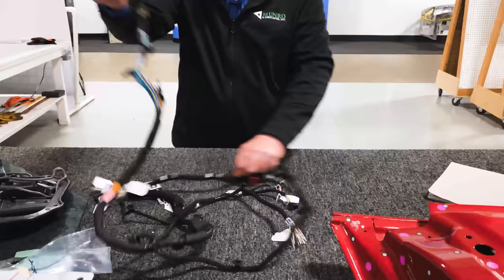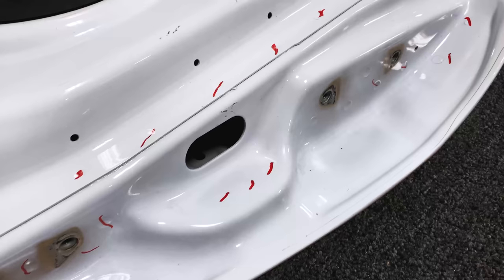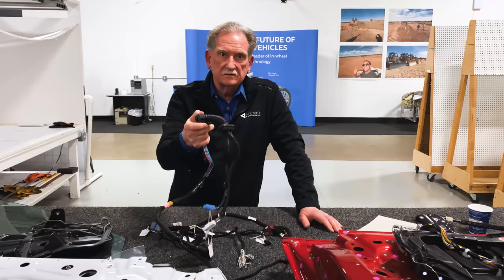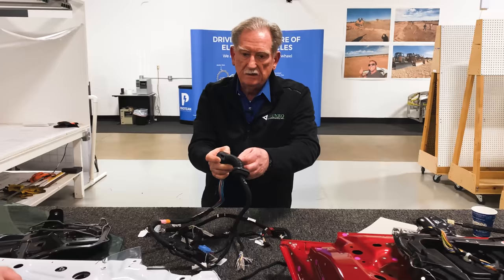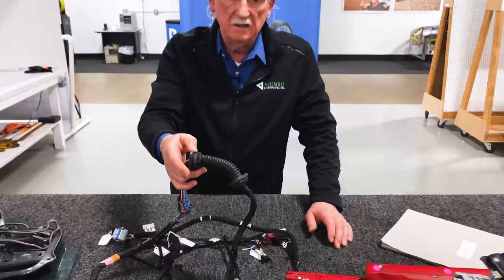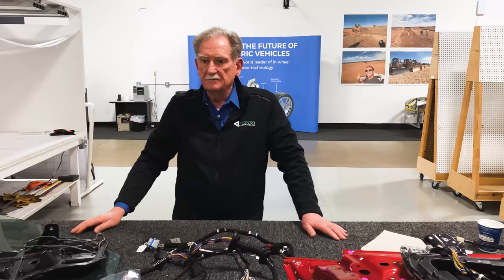One thing that really is difficult to make work are these two connections right here. One I can pull through, but the other I have to wangle into that elliptical hole right down there. I tried this on the assembly line when I was trying to sell this to the Ford Thunderbird — the Fox platform — and it was a nightmare. You had to have a guy with unbelievably strong hands to pull that in, use a special pair of pliers, and you still need grease to make it pop in. By the time you pull everything in, it's gotten cold again, and it makes a living hell for the guy on the assembly line.